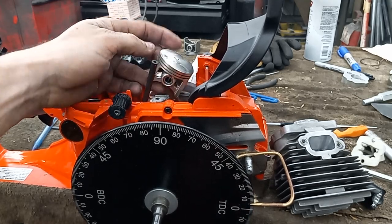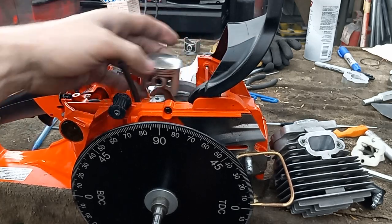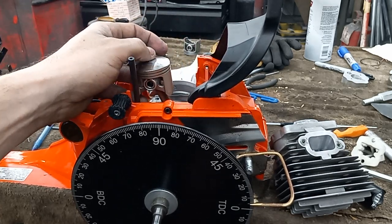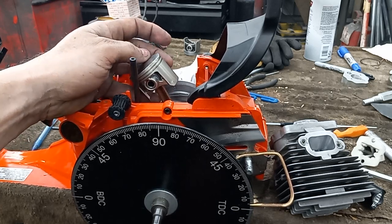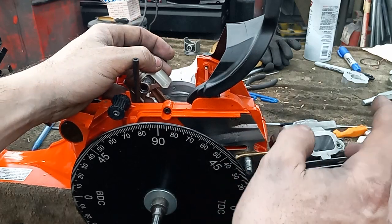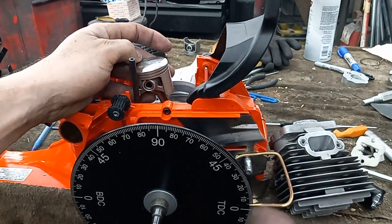The windows are widened, underneath here is lightened up, the windows cut there. Top of the pistons has been shaved down on the exhaust side just a little bit, and that allowed me to make full use of my port.